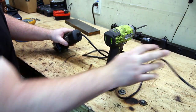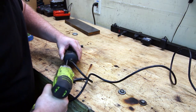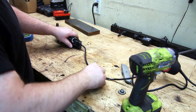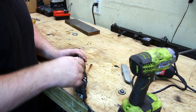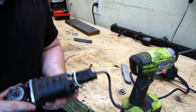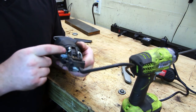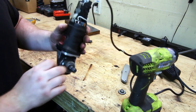Our power cord is unplugged. In the back there's just one screw that holds the rear casing on. Sliding that off the back — you saw how on the other unit there were removable brushes. On this unit the brushes are not removable, or at least not obviously so, because you can see they are riveted in. So basically, once the brushes burn out on this unit, that's it.